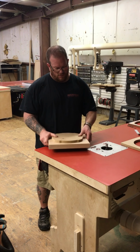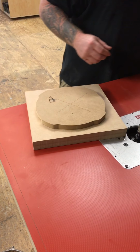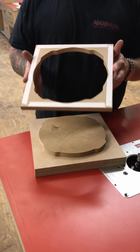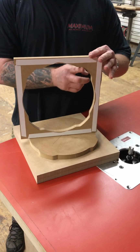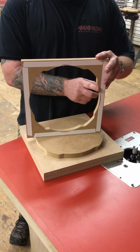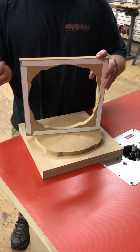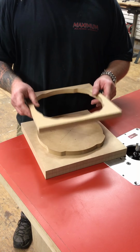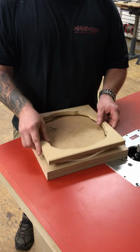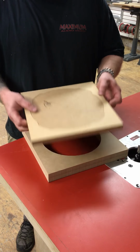Now this is our alignment. We can put the woofer anywhere we want, however we want. We'll put an offset or square it up or however you want to do it. You can set it this way, you turn it. Then comes the next piece, piece number 3. This is the outer ring. So this is the outside of the TW3, and it's pre-gapped. So this is already set up to do carpet, with a little bit of gap on it so that the woofer can go in and out, and you don't have to pry it out. And this aligns like that. So now you have that piece.